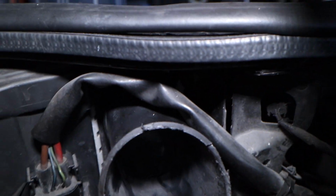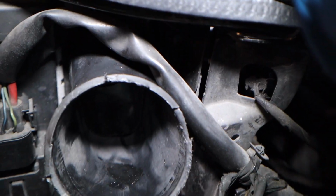So now we're going to put my little makeshift heat shield on. First thing, before we put the intake back on, make sure you put that hose on. That hose fits pretty good. Also, what we have to do for this little thing is, here's the factory one, but if you can see, I cut the end off of it, and that is right over here now. It's back where it was factory, so I cut it off so you get air that rams right into that little hole over there, and I can fit my piping in.